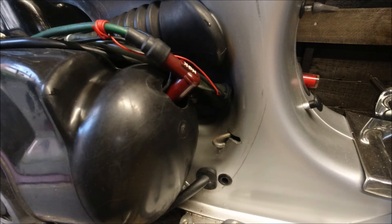That's a place to check — inside there the cables can fall off as well. They've got a very small little push-on connector on them. I have got one somewhere I could probably show you, but like everything I can't locate it immediately. I do carry some spare parts like everybody — it's a wise precaution. I've got spare cables, stator plates, flywheels, etc.